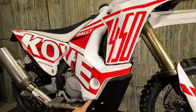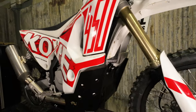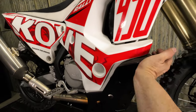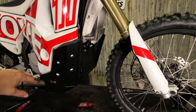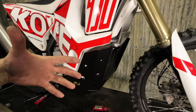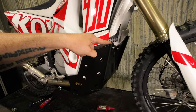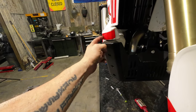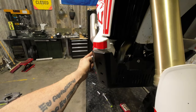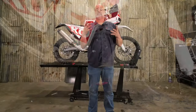We're going to get some questions about the spacing up here because the strength is down here and we just have that one M6 bolt at the top. We did not want to put the upper section of the skid plate right against the tank — if you take a big hit there's not a lot to keep it from moving. We wanted to flare it out a little bit, but we don't want rocks getting in here; a rock sitting between the skid plate and the tank will sit there and wear the tank, which is why we put the foam in. And if you drop the bike and it's sliding along the ground, we wanted the skid plate proud of the tank so we're not grinding away on the tank. The skid plate is proud of the gas tank all the way down. If you have any questions, info at camel-adv.com — thanks for watching.